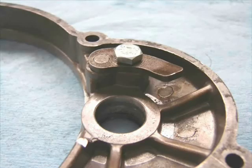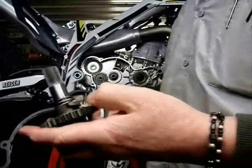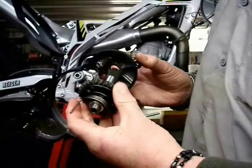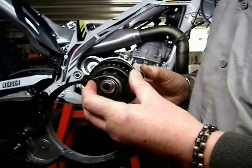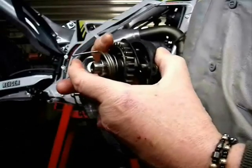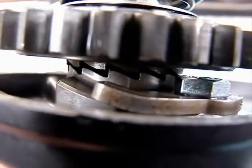When the shaft is pulled around, that's what winds the kickstart return spring. There's no winding of the spring before you put these parts together — that is done in final assembly. That little thumb falls behind the ramp and opens the gears. When the bike is running, that gear — the kickstart idling gear — is free to spin.